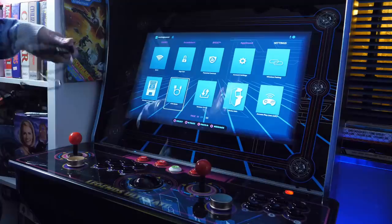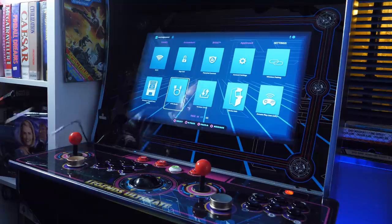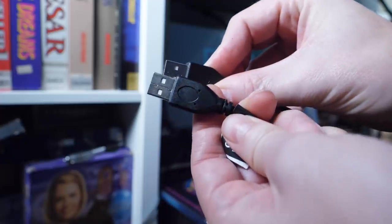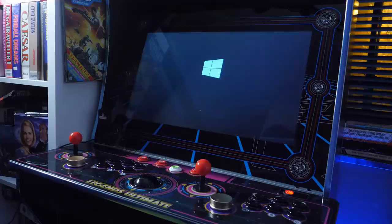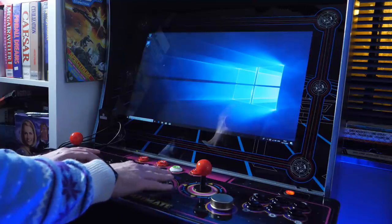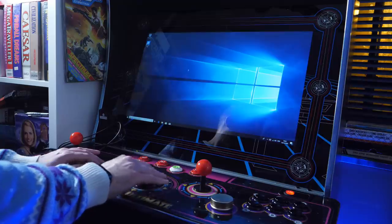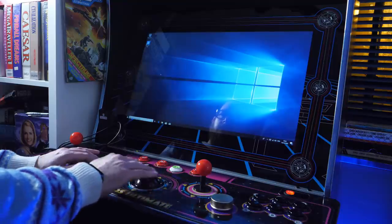But this functionality has other uses. You see, the machine has OTG functionality, meaning you can connect the USB up to a range of devices and then use the arcade cabinet controls. For this you'll need an absolute abomination — a USB-A to USB-A cable, which really goes completely against the OTG specifications. But it means I can plug this mini PC into the HDMI slot, connect it up via USB, and then use the arcade controls within the PC. Here I'm using the trackball as the mouse. And just like our local and virtual server options, you could plug in a Raspberry Pi or a gaming box, and then control them from here.